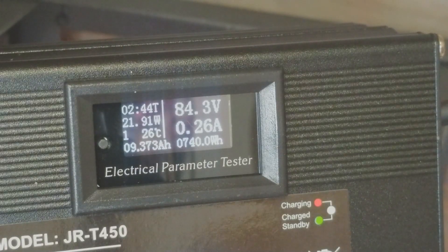Look what we have — a battery connector that's not connected. It's disconnected, and they're supposed to be zip-tied too, but there's no sign of a zip tie in here anywhere. After isolating each battery and charging them separately to 100%, then reconnecting everything for a top-off charge, the range test shows much better range. As a disclaimer, we are aware some countries require batteries to be disconnected upon shipping, and we were given no indication ours was disconnected. Thanks for watching and thanks for subscribing.